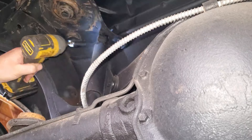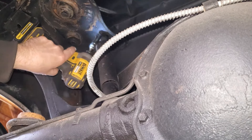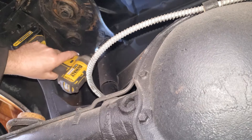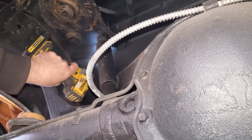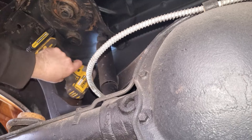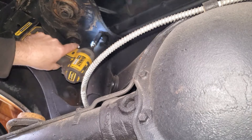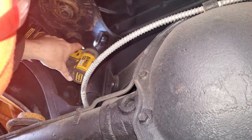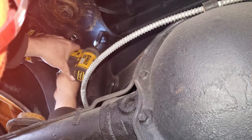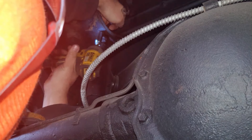Here's the top side of the shock — that's what we're looking at. This one here is really easy to get to; this one here is a little bit of a pain but it is definitely possible. Our bushing up there is super worn out, which works in our advantage because we can actually pull the shock to the side a little bit. I'm going to try and just hit it with an impact — sometimes you get lucky and it'll spin off the top. We're not reusing these so I don't really care, but if you're going to reuse them it'd probably be a good idea to keep hold of them.